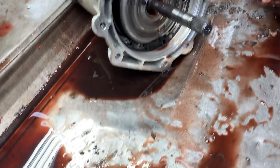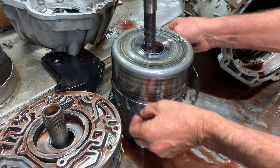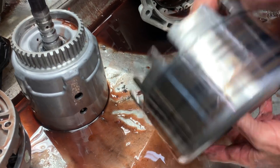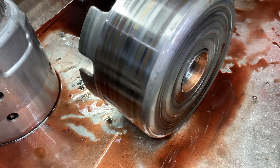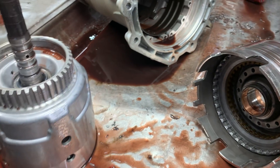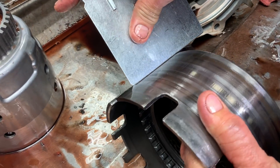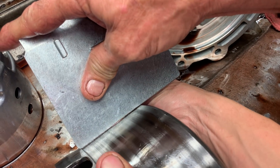Always want to get your band anchor out of there — that way you can just grab it and pull it. Always want to make sure you have a big or small hole here. Now look at that. Even though we see this marking, it feels really good — it's more just seeing it. The drum looks really flat; don't see any wear in there. Looks like we can probably put the drum back in — it looks really nice.